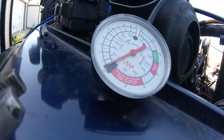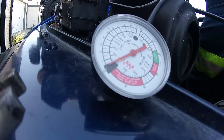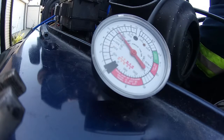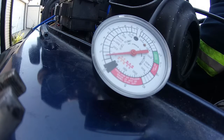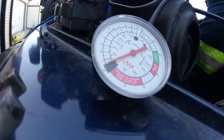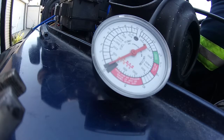In another video I covered this. This is using a pressure/vacuum gauge hooked up to the cylinder I wanted to test. As I'm cranking the engine over by hand, you can see I'm reading pressure. Then once I pass TDC and go down, I start reading vacuum. Once I've passed, I reverse it and go back, and when the needle bounces right around zero, I'm right at or dead on top dead center.